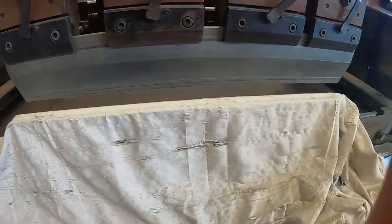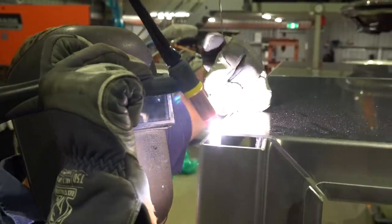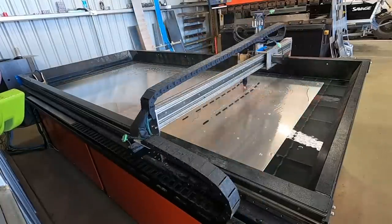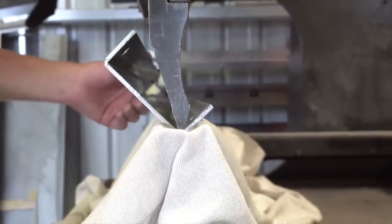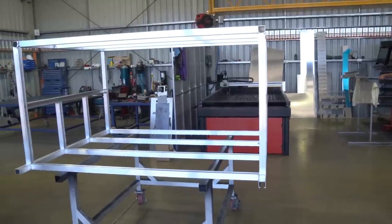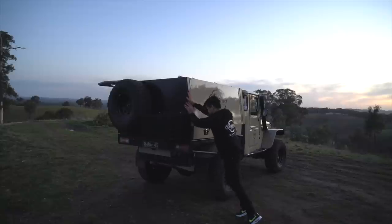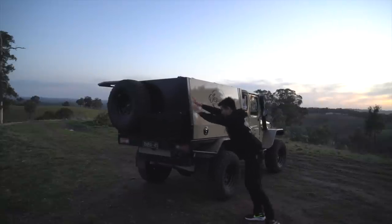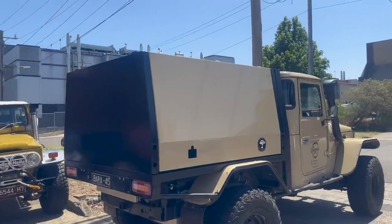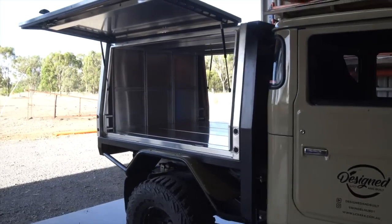I enlisted the help of Justin and his CNC press brake from Ailet Custom Fabrication, using his workshop for the weekend to get the canopy built. The canopy is constructed from 3mm aluminium sheet, cut on Justin's CNC plasma table before getting folded in his CNC press brake. The subframe is constructed out of aluminium uni strut, which allows everything to be mounted quite easily. This canopy is fixed to the tray with four M12s with oversized washers, one on each corner — it's not going anywhere. I roughed up the aluminium and shipped it off to my mate Shannon, who painted it in Valspar.